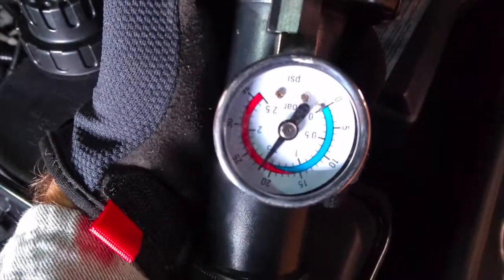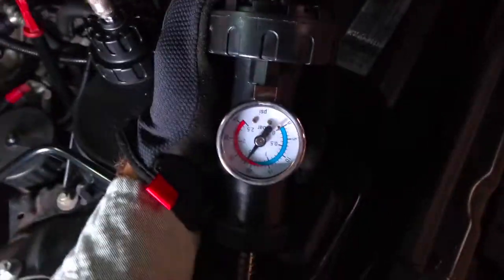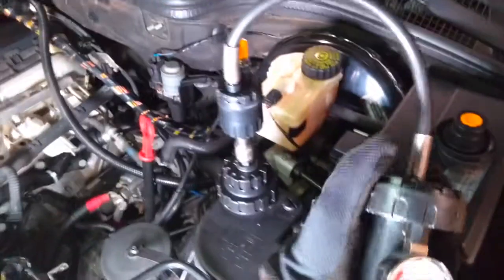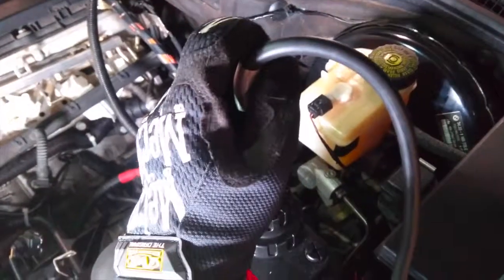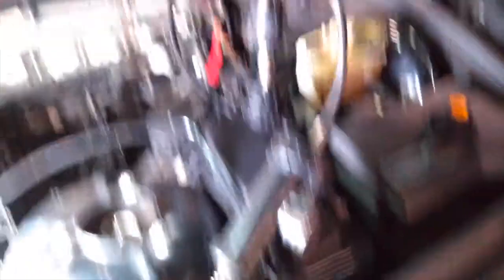It's been about five minutes now and that needle has barely moved downward, so I'm going to call this a mission accomplished. No leaking that I could find anywhere in the engine bay. It's holding up pressure. For $80, this is a nice bit of kit. Quality could always be a little better, but it did exactly what I wanted it to do when I needed it to. So I'm going to go ahead and depressurize the system by pushing down on this plunger here very slowly — just get that air out. I think this is going to work.